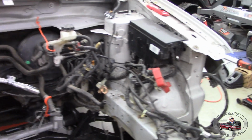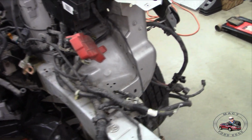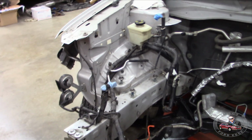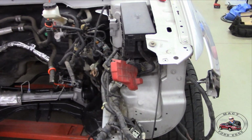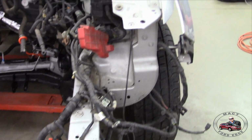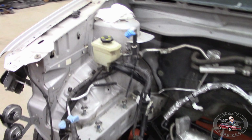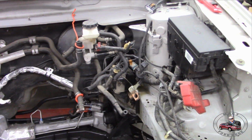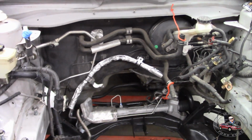Every connector, every electrical connection here will be sprayed out with MAF cleaner and then some dielectric grease put in there to help keep them fresh and easy to plug in. That's right. We have found out that cleaning them and putting dielectric grease makes them snap and click in so much better. So as we do connectors, we will do cleaning and we will do dielectric grease to make sure everything works good, because we found out that that was needed in the back end of Herbie.